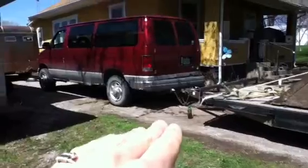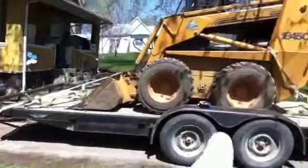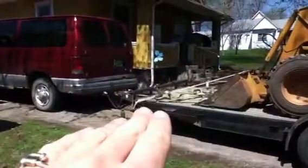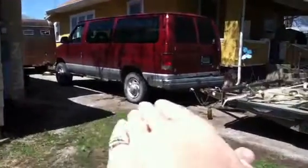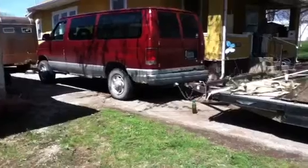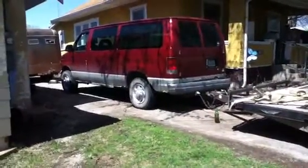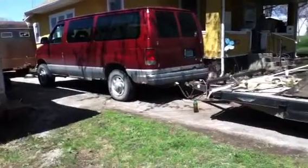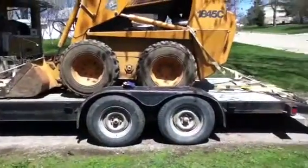If you have all the weight in the front, your tail end — your van or truck — is going to stick way down, which makes your front end really light and hard to steer. If your load is too far back, it's going to hold the tongue way up in the air, your drive axle won't have traction, your back end will skate around, making it hard to drive — you'll spin out and get stuck. So try to keep your tow vehicle as level and flat as you can possibly get it.